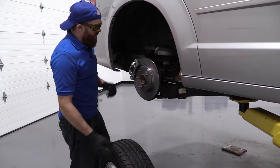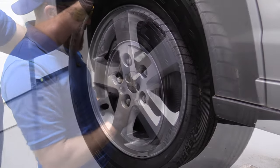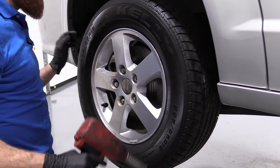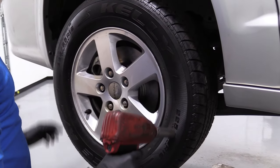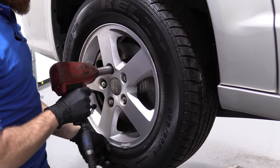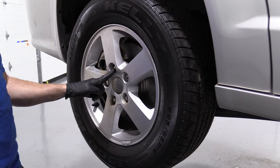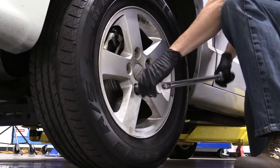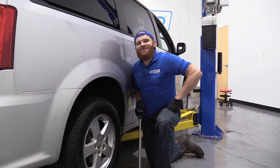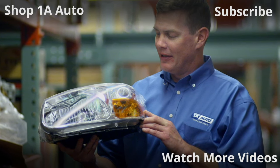It's time to get the wheel up on here, just like that. Get one lug nut started. Now it's time to bottom out these lug nuts — go in a star pattern or crisscross. The reason is that if you tighten them in a circular pattern, it could be off kilter and your wheel could come loose after hitting a bump, which is very dangerous. Now that we've tightened those down, torque these to manufacturer specifications. Go around one more time — small price to pay for safety. Easy peasy, thanks for watching. Visit 1AAuto.com for quality auto parts shipped to your door, the place for DIY auto repair. And if you enjoyed this video, please click the subscribe button.